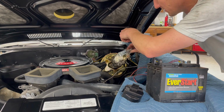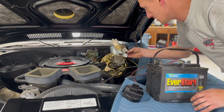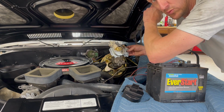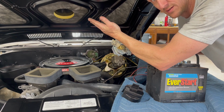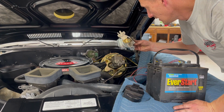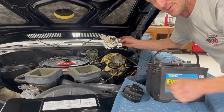That way this actually aligns with the pump arm that's controlling this washer. Otherwise, it's gonna get stuck under here and do what you saw. It'll just run up just a touch and it'll burn the fuse up and cause issues. So I don't know, just wanted to clear that up. So get that in, screw it back on, pull the alignment pin out, and you'll be set.